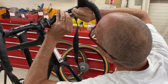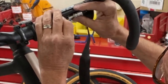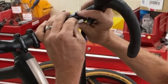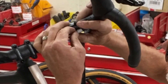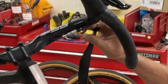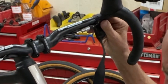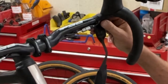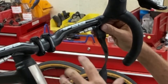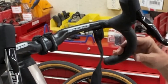This will snap in — there we go, it snapped in. This is the spiral O-ring I told you about. This slides over and this is what keeps this from disconnecting when you don't want it to, which is not a good thing if you're going downhill. So it's connected. Now all I really have to do is tape it back up, adjust the handlebars where I want them, and that's it. No re-bleeding.